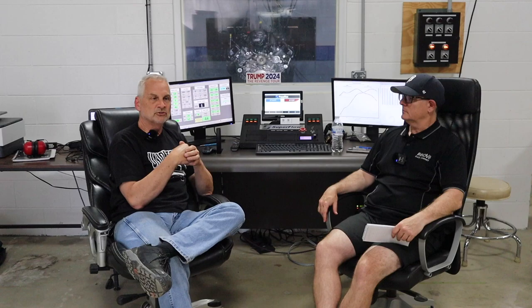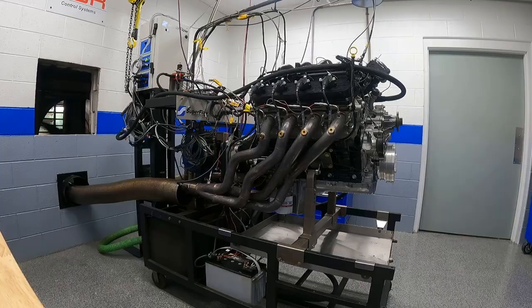What the inertia factor does is account for the power taken away from the flywheel as you accelerate everything inside the engine. This is the same reason putting an aluminum flywheel or lightweight rods and pistons makes an engine rev quicker — there's less inertia to overcome. After calibrating the inertia factor with Superflow, since all the engines Brian tests are Godzillas with similar bob weights and valvetrain, his baseline changed by about 10 horsepower, explaining why his numbers were a bit lower than others.